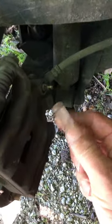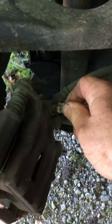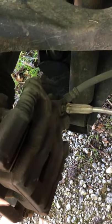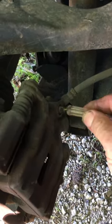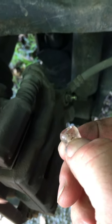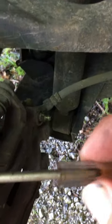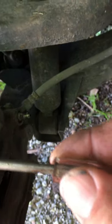One thing you need to do — very simple. There's a taper on this and this little ball: if you put that on the bleeder screw and start putting pressure to it, it tends to work back off because of the bell in the end — it'll go on then pop back off. So what you do is remove that first quarter inch: just snip it off, cut it with your knife. I've already done that on this one — that gets rid of the bell and then you can slide this right up on there. I've been using this one and it's full of fluid; I just stuck an old Phillips screwdriver in to keep it from leaking. Now I'm going to put it on this screw.